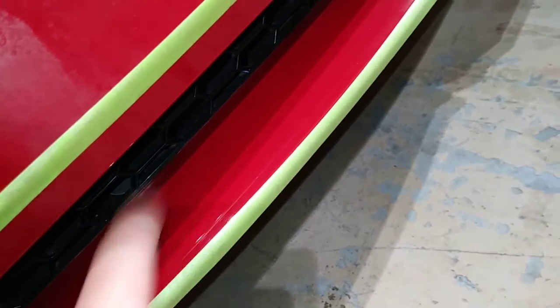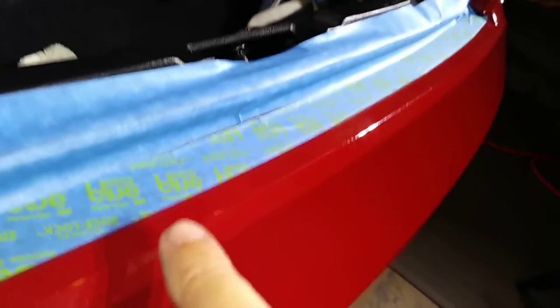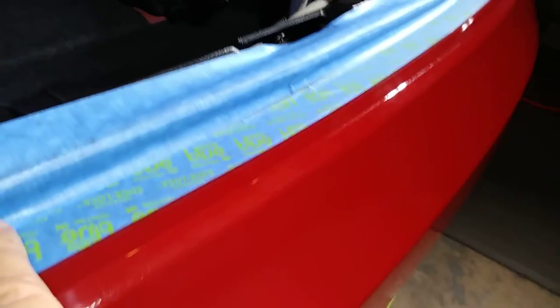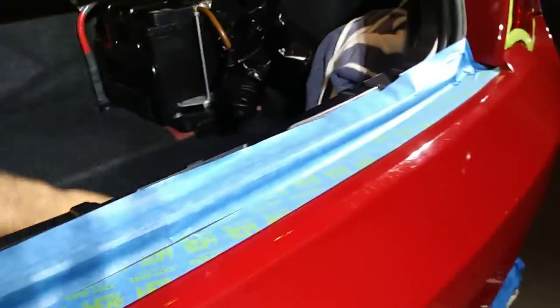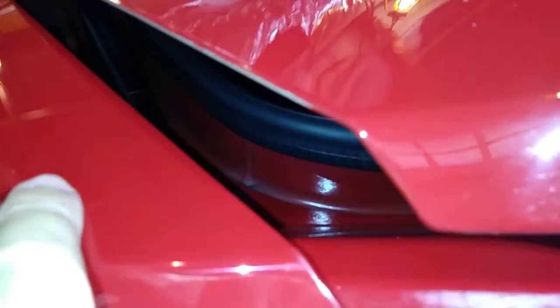You can use some very thin tape to protect edge lines and little bolt holes. This is where the license plate cover is. I've got a VIN number tag — I just put a piece of tape over that. Also these edges — this is a nice curved edge, but with the nano rotary polisher I'll spend a little extra time on the flat area, then take the tape off, clean it up, and polish out the edge. On this trunk area, there are a lot of scratches and scrapes from a previous owner. Protect this plastic trim line so you're not scuffing it as you get in nice and tight along the line. I've got a little extra fat tape here too — when I do the trunk section, I can raise this up and bring it down, then work on these edge lines without worrying.